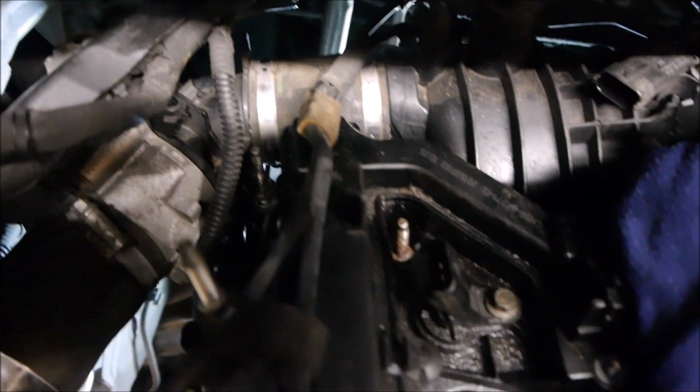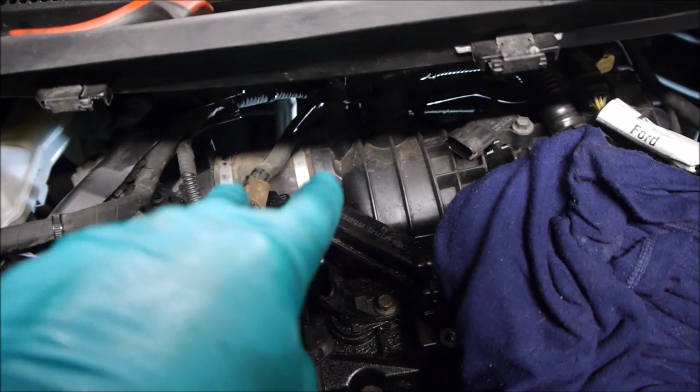This here, on the throttle body, these Jubilee clips are in a nice position upright. All they needed was a screw fitting here and here so you could take this throttle body off. Oh no, they're right at the back that you can't get the screwdriver into behind to take out. What's happened is, when this engine was off on the floor in the Ford factory, it will be easy to get those screws in at the back. Some maintainability engineer should have realised that these Jubilee clips should have been there.